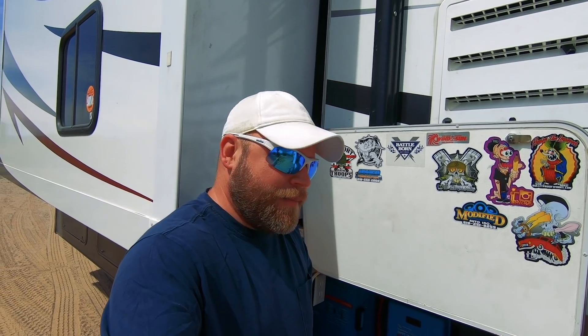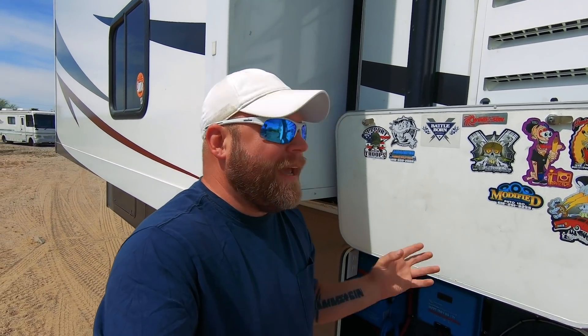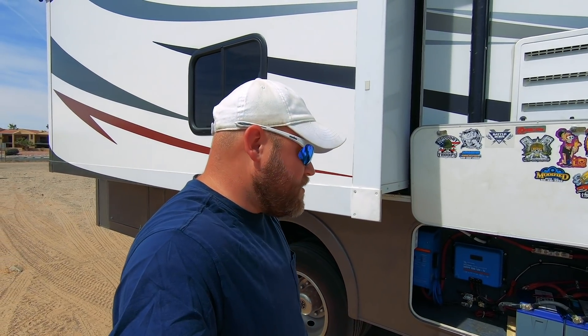The system is maintaining 100 percent on the batteries even in April. When I put a big draw on it — percolating coffee, running all the TVs, even the air conditioner — I can run it off just three lithium batteries and this 3,000-watt inverter and barely make a dent. I'm bringing in 90 amps of solar while the roof AC only draws 44 amps, so the batteries aren't even being depleted — they stay at 100 percent.